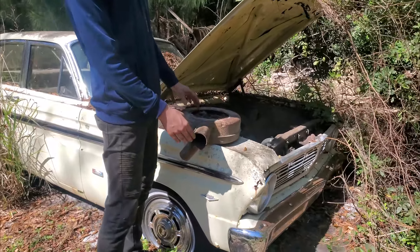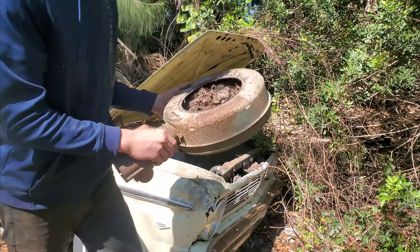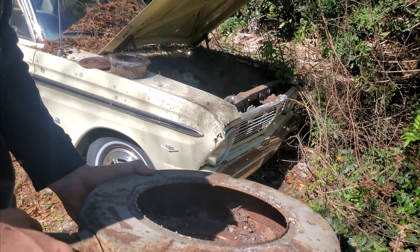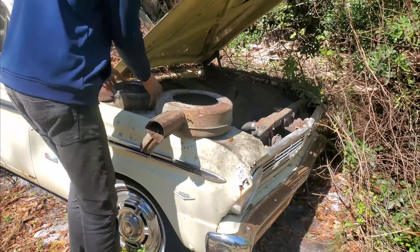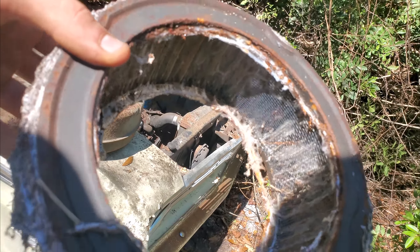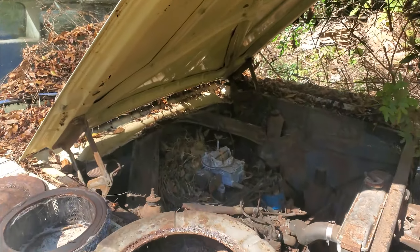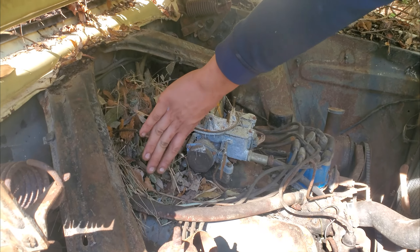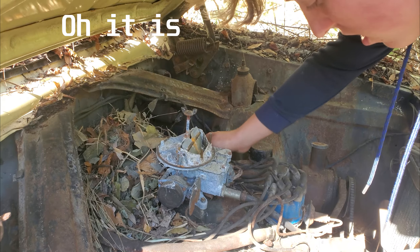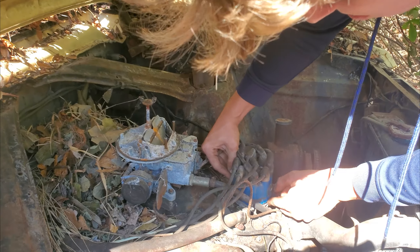I'm back at the car here. First time you guys are seeing it with the air cleaner off. You can see it's not doing a good job at cleaning air. None of that mouse poop and whatnot has got past the air filter, and the carburetor doesn't look half bad if you look over here. It's dirty behind there, but it's hard to tell if it's locked up because I can't see much. I'll worry about that later. I bet with a simple carb rebuild that two-barrel is going to be fine.